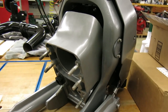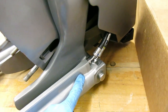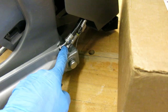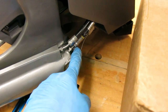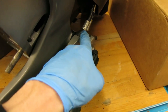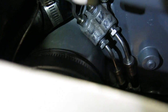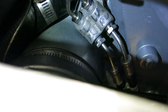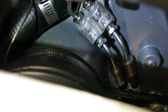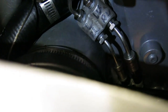Out-drive addendum. As I was putting the finishing touches and installing the trim cylinders, I discovered I had made an error and wanted to come back and highlight it so other people don't make it as well. When you're putting the hydraulic lines onto the trim cylinders, there are two different fitting shapes — one is bent and one is straight. The straight one goes on the lower fitting; the bent one goes on the upper fitting. Both sides are the same, so both bent fitting tubes should route to the same spot in the manifold. I had mine labeled LU and RU — left upper and right upper — and LL and RL for left lower and right lower. I had one straight fitting and one bent fitting going into each port, so I had to go fix that. Otherwise my cylinders would have been fighting each other when I went to hit the trim switch.